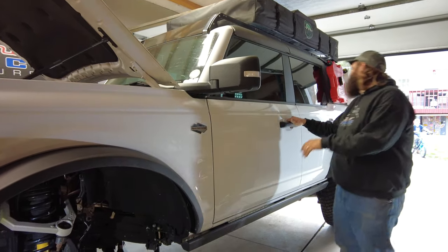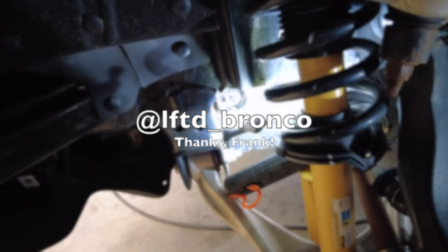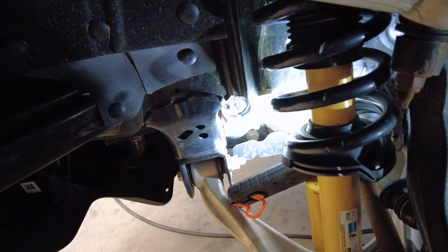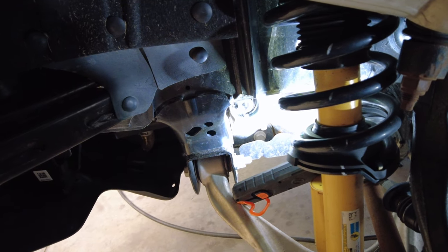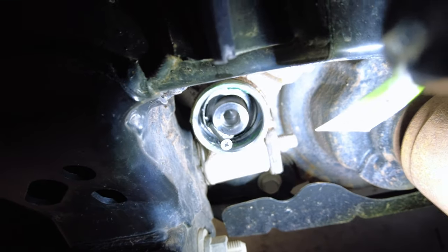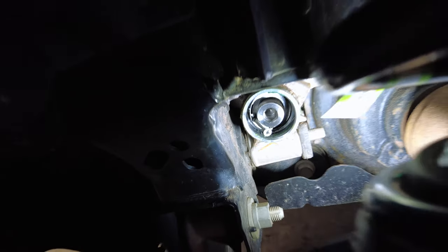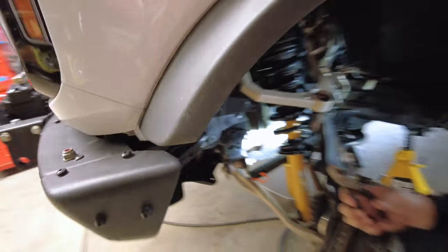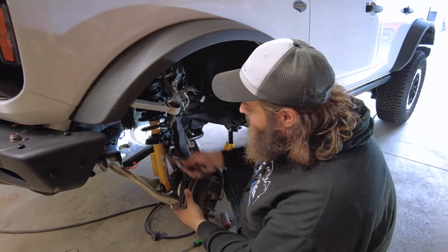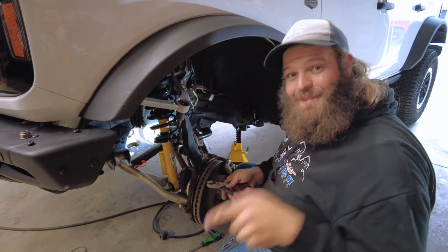When we were down in Texas, our good friend Frank with a lifted Bronco - you know who you are - we replaced your coil over, that was a great time. He taught us that anytime you're doing a bushing, you just simply screw a screw into the factory plastic piece that's already there, then you can reach in there with a pair of pliers, pull on that screw, and that bushing comes right out. This is the first one I've done, so I hope you're right Frank - thanks for the good advice!